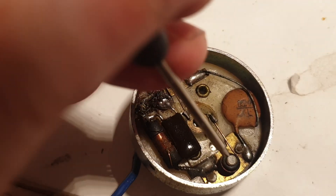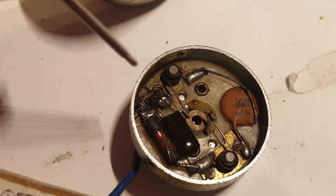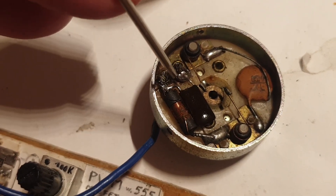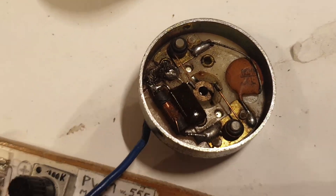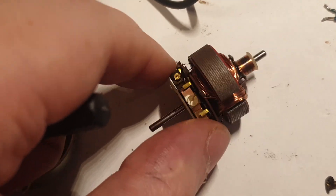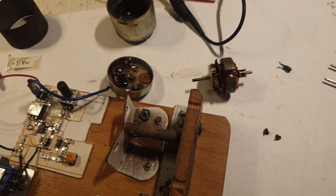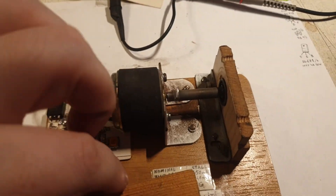I was scared when I saw smoke — I thought it came from the coils. I tested it and it's working fine now after I changed the capacitor. Inside you can see a single wire linked at this point and that point, going through the two brushes, and between here and here is a capacitor, and between the two power points is another capacitor. It's a bit weird — probably helps start the motor. Anyway, I repaired it, so let me assemble it and show you it works.